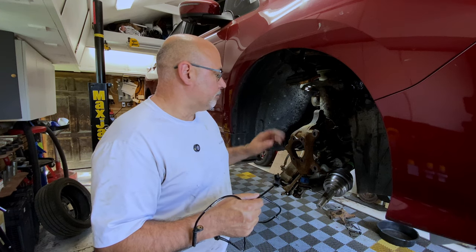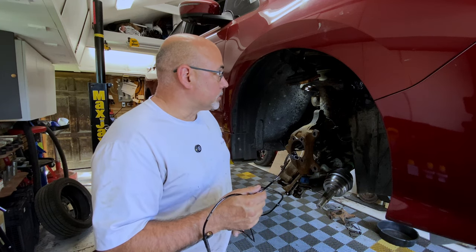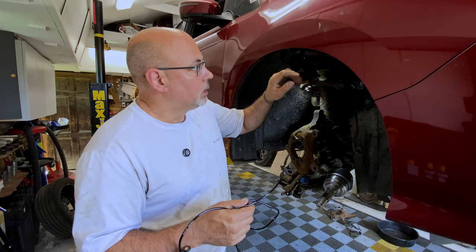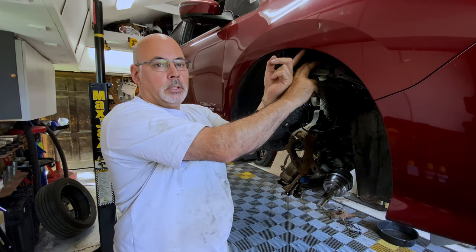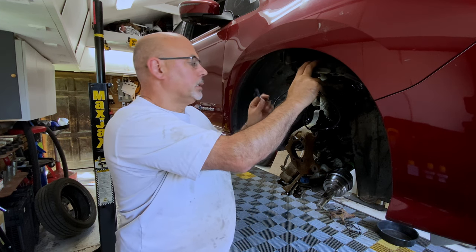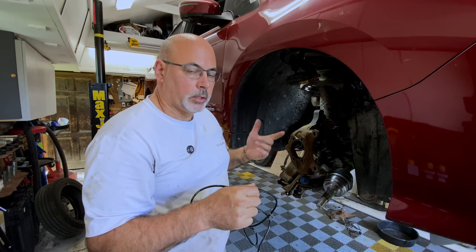But in this case it's super easy. If you need to buy the new ABS wheel sensor assembly, the good news is you can just pull apart some of the plastic clips in the fender liner and the harness is actually sitting right here. We'll get another camera angle so you can see it — you just follow the routing of the old one and pull the fender liner down to get access to it.